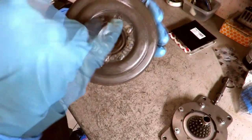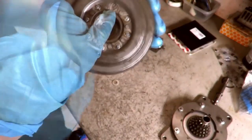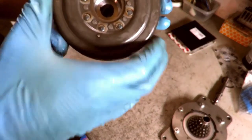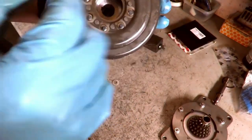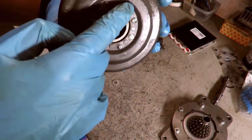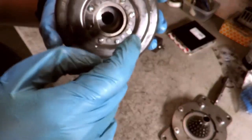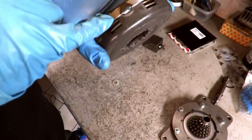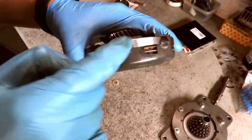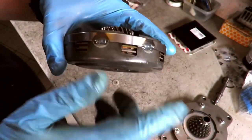In other words, the possible detachment of the pegs that hold the springs is solved through 8 welding points that bind the internal basket to the internal bushing where the spring holder slides. And so this problem has been solved. The other problem, namely the opening of the basket, has been solved by means of a reinforcement ring.